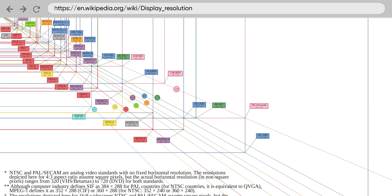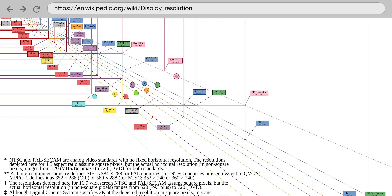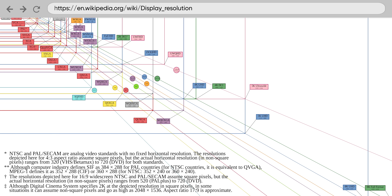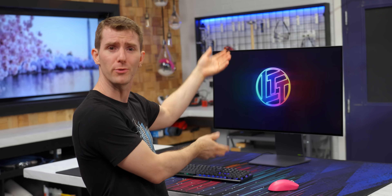We can see how well it actually scales if we try any other resolution including 720p — and it gets blurred. This is unfortunate because they could have integer-scaled 720p as well. That would mean the lion's share of common resolutions over the past two decades would look perfect on this display at 480Hz. That would be awesome if LG could rectify it in the future, but if not it's a pitfall that hopefully other manufacturers using similar technology can avoid.